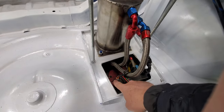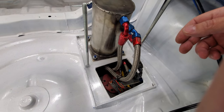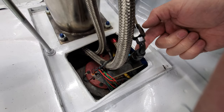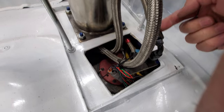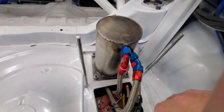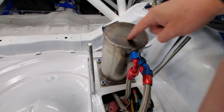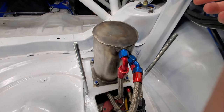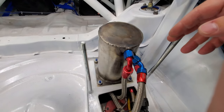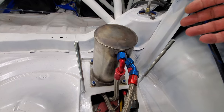The way mine is set up is inside the tank down here I have a standard Walbro — just a regular fuel pump, I believe it's a 255 — pushes fuel up. It actually goes up through here, goes through my flex fuel sensor because on the Haltech we actually do read that. It then comes into the tank itself here off to the right, and you're going to notice the way that this guy feeds. The reason why we feed it this way is this creates what's called a swirl pot. So as the fuel enters in here off to the right side, it will sit here and swirl around in a circle. That will de-aerate the fuel — it basically removes all of the air from the fuel if you have bubbles or anything like that, rather than just splashing in from the top. It honestly just provides a quite a bit better solution because it is actually a swirl pot — it is removing the air from the fuel.